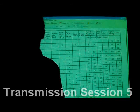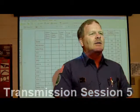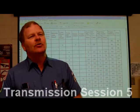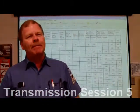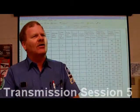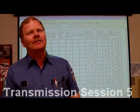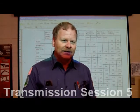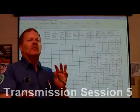I'll tell you what happens when you think you know. I got so comfortable putting spark plug wires on GM cars — Chevrolets with the 1-8-4-3-6-5-7-2 firing order. One day somebody threw me a Cadillac, and I did the same thing assuming it was the same GM V8 firing order. Fire was coming out the back and out the carburetor. The old guy that ran the shop said look that up and find out what firing order you've got. Turns out the Cadillac had a completely different firing order. If you think you know, you can get yourself in trouble.